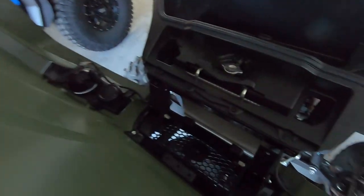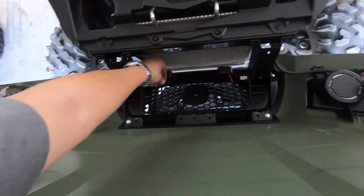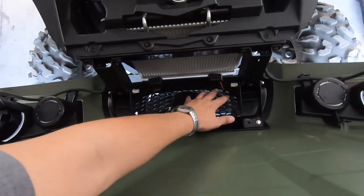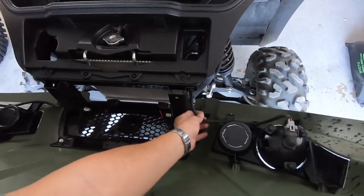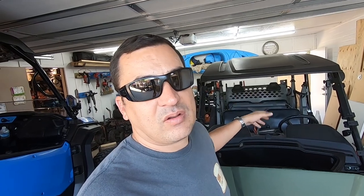As I pop the hood, here are the wires for the lights the owner wants. This is in the folded-down position. We're going to attach these wires together and run them up basically with the factory harness up into the dash — that's going to be the really easy install for the front lights. After the front lights are installed we'll move to the back, and finally we'll do the fuse box and the stinger switch.